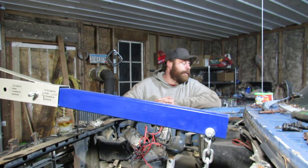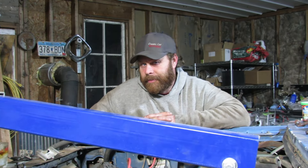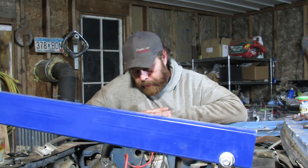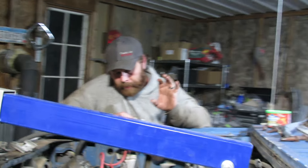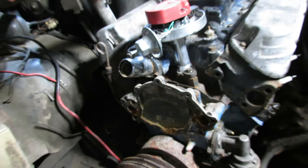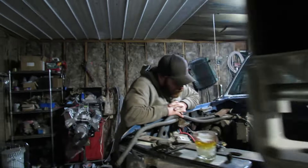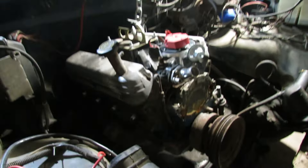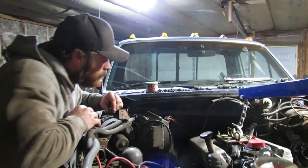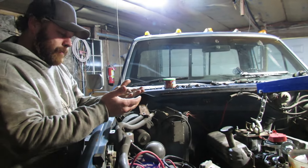We're back at it on the DRW — dual rear wheels. I was at a standstill waiting a couple days for the gaskets, but I've got the heads on and torqued down, intake torqued, and I swapped the oil pan so now I've got a drain down there for the turbo. When I was setting the engine in, the motor mounts aren't going to work, so I called O'Reilly's — they said they'll have a set in the morning. Tomorrow after work I'll lift the motor back up and swap motor mounts. The transmission cross member looks like it will work perfectly, so I just have to shorten the driveshaft to meet the new transmission.